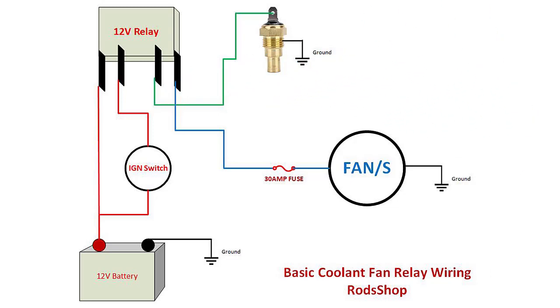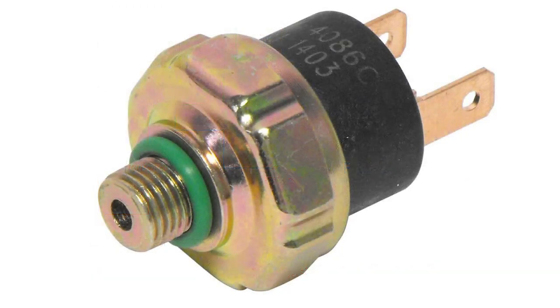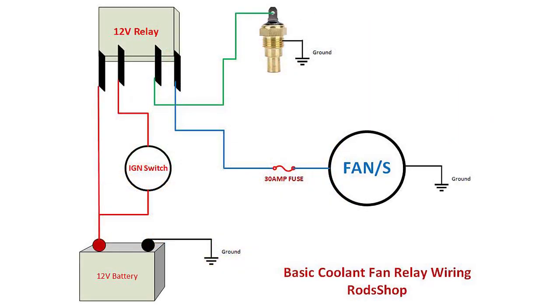Another way of doing it would be the same setup, but instead of a temperature sensor you would have a pressure switch, and that may require going back to the two-prong sensor setup where you run positive through it instead of grounding it. If you have questions and need help wiring it up with air conditioning, leave me a comment or send me a message through my website — show me pictures or whatever you need. I hope this video helped you. If it did, be sure to like and subscribe and always check back because I'm always working on something interesting to share. See you in the next one.